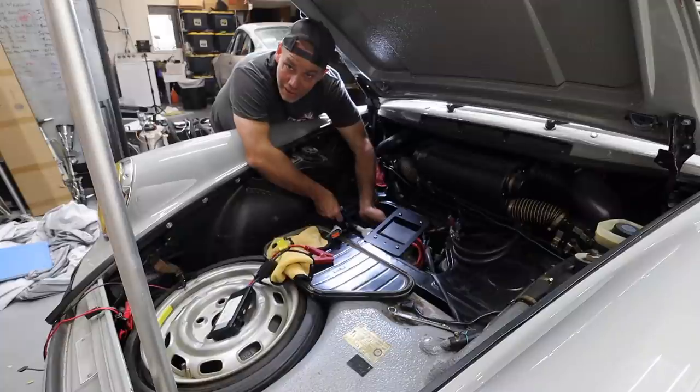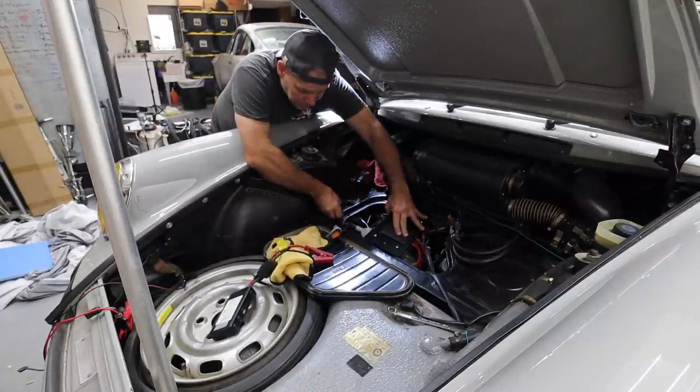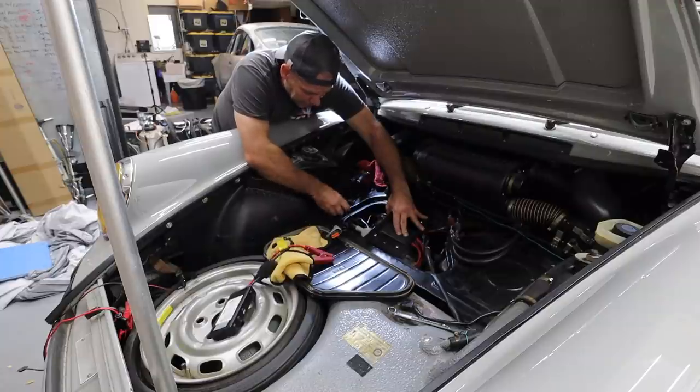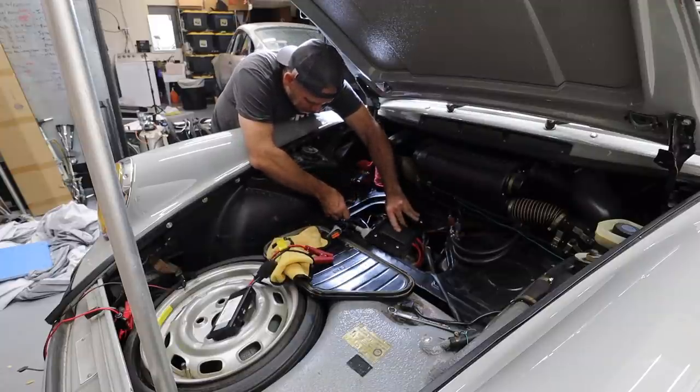But the important part is tomorrow morning, I'll be able to take the car to the air conditioning place and charge it. And if there's any issues, we'll have the issues in the morning and hopefully be able to solve them by the time we have to leave. Now, because this circuit is doing two fans instead of one, and those things are pretty bomber, I need to beef up the grounds that are part of the relay on that circuit.